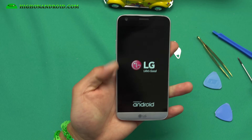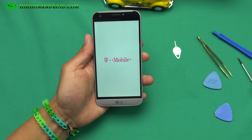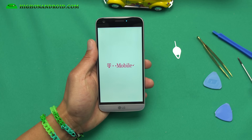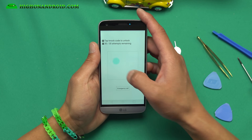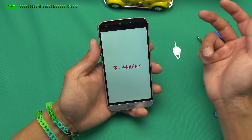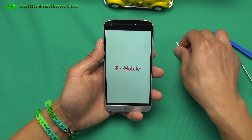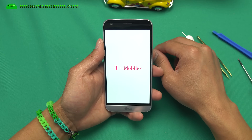Power on. We'll go ahead and test it out real quick. Flawless repair of the LG G5. Things you've got to test out are basically the cameras, Wi-Fi, and make sure data is working. Data you shouldn't have to check because we didn't have to mess with any antennas — like with Samsung phones, sometimes you mess with the antennas, forget to put it back, and you can be kind of screwed. We're just going to check the camera and the sound. The sound just worked. The camera is probably the most important. The display is working. Touchscreen should be working — it is working. Very simple to do.